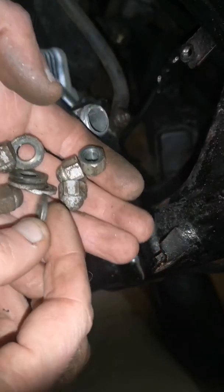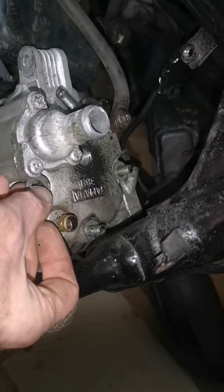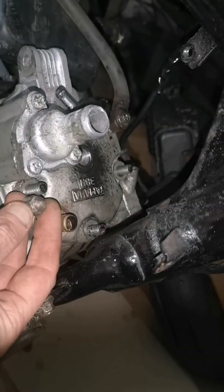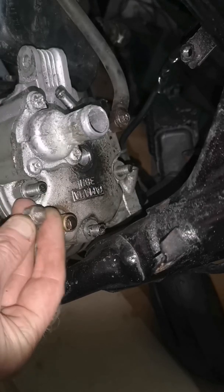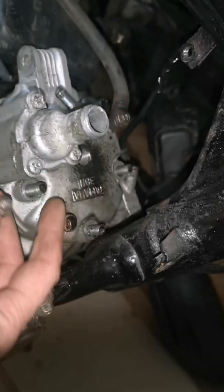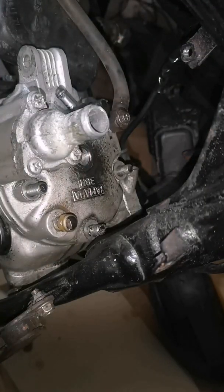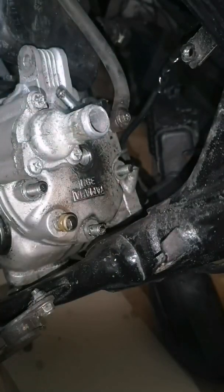That's all the bolts out of the head. Just remember they've got a washer underneath. The washer goes there. If you don't put the washer on, the thread comes through the top of this bolt and splits it. And that's a waterproof protector for your head. Right, we'll lift the head off now. Then we'll put all these back onto the 5 bolts when the head's off.